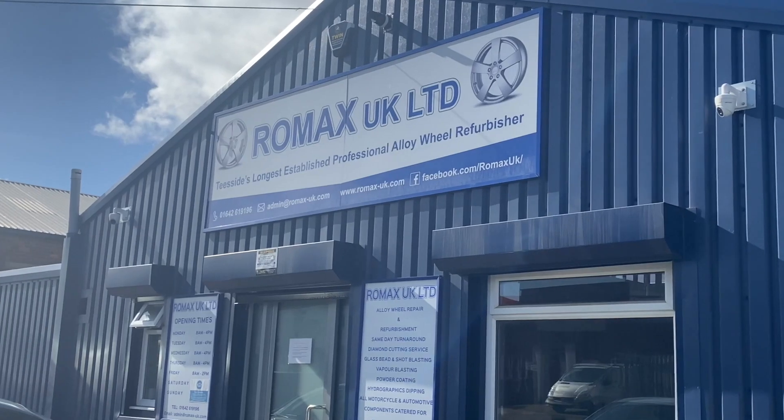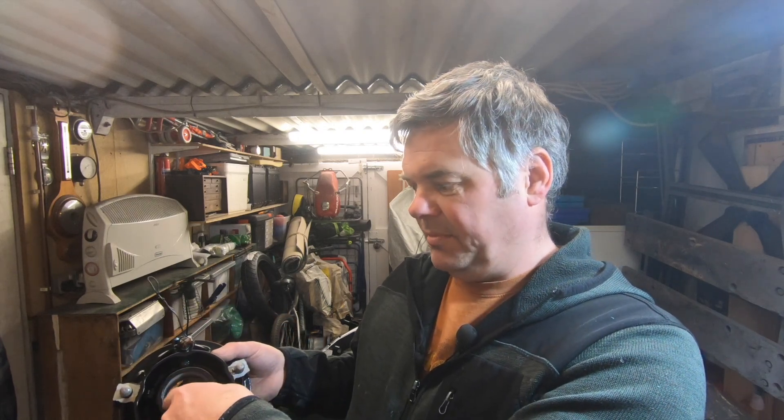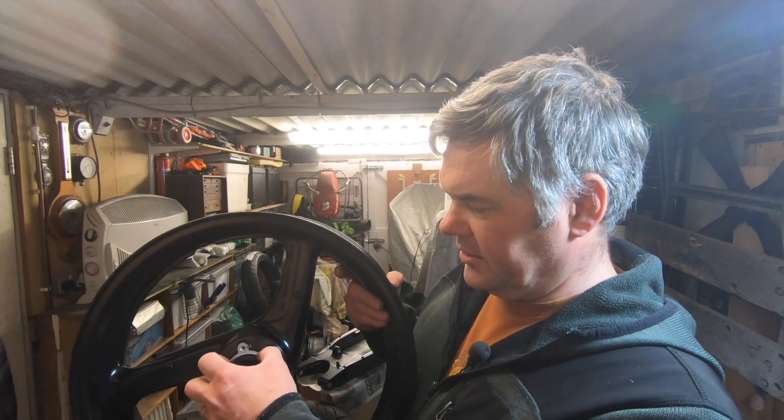Ignore the unpainted engine behind me — I'm going to put the wheel bearings in. I've got new bearings and seals; the wheels are shot blasted. The people who did the shot blasting and powder coating, RoMax up at Stockton in the Northeast, were brilliant — really helpful, good price. All the prep I did putting bolts in and everything, he said you needn't bother, they do all that included in the price. He masked the bearing faces with shimming plastic and masked the bolt holes. I'll put a link to their address in the description.